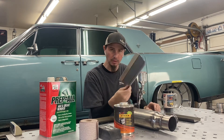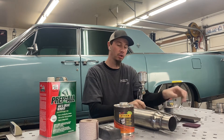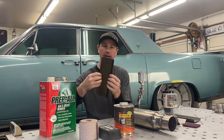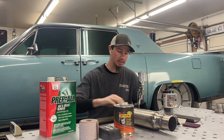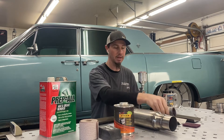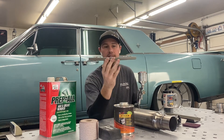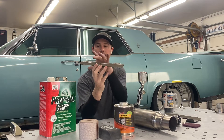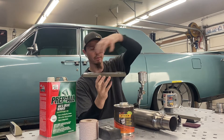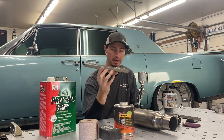I started out with basically some four-inch wide 5052 aluminum that I was able to stick in my sheet metal brake and create these broke edges. Then I took a piece of 6061 aluminum and my two-inch hole saw and cut myself out some round discs that I've welded to the bottom. That gives me about a quarter-inch air gap between the floor pan and this particular shield, so there's air movement around this part all the time to keep it from getting too hot.